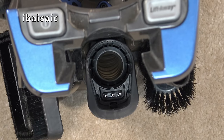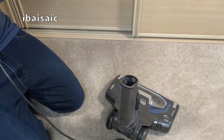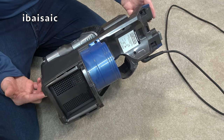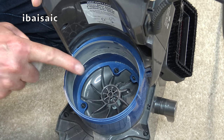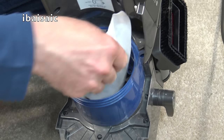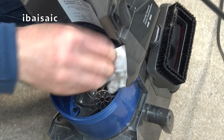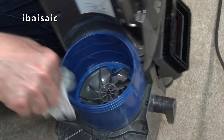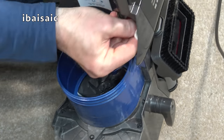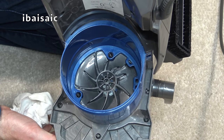With the wand removed, you can check for blockages in the air path here. To remove the suction pod, press the lift-away button and take it out. There's not a lot you can do with the motor unit in this state, but now's a good time to give it a wipe. Most of the dust will be located just above the motor where the filter is housed. I'm using an antibacterial wet wipe to clean it — don't use anything more than a wet wipe, damp cloth, or dry duster; you don't want any water going into the motor. That's nice and clean and ready for the clean filters when I reassemble later.